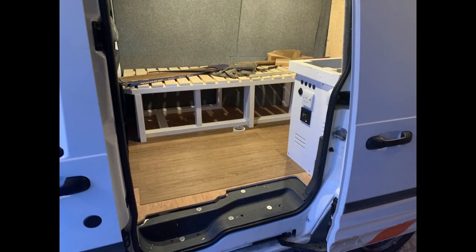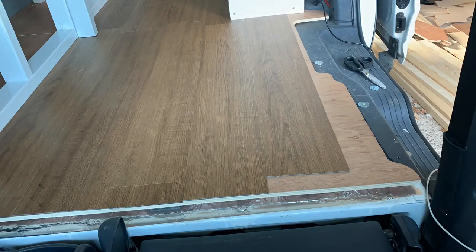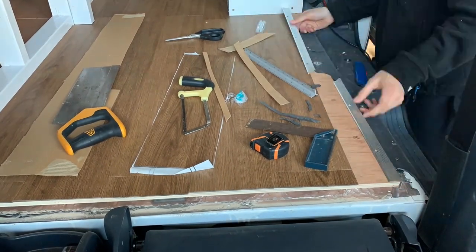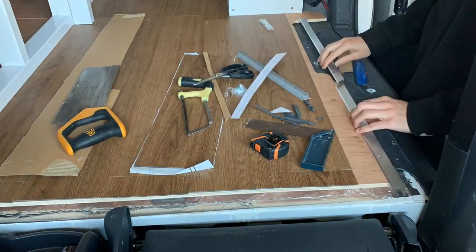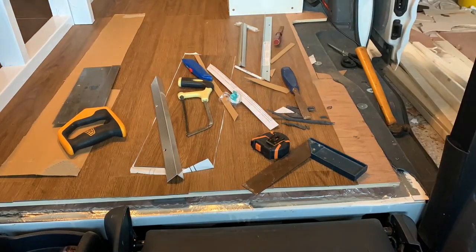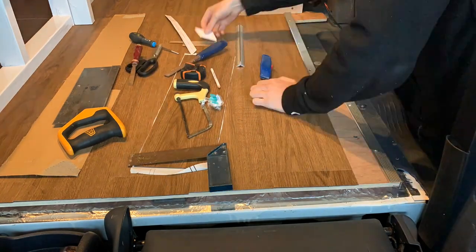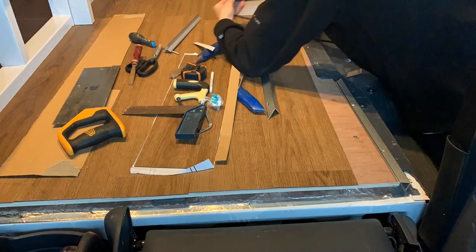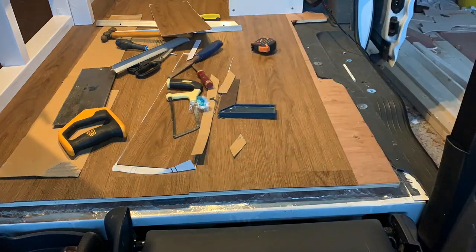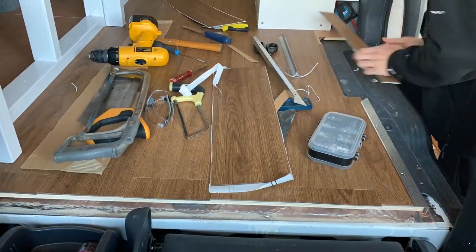Here are a few photos from the first fix of the floor — it really didn't take too long, just a couple of hours one evening. I've still got the more difficult pieces to lay around the edges and the footwell. I originally cut the ply floor to suit the curve of the plastic step, but in reality this made it much more difficult with the floor edging, so I decided to square off the curves. I then added the final pieces of vinyl planks to this section.